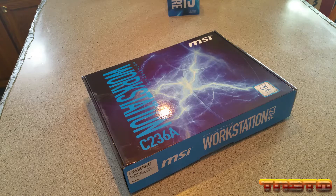This is going to be the first part of building our custom FreeNAS build. I picked out a workstation motherboard because it supports ECC RAM and has an Intel NIC. Workstation motherboards are a lot better than using consumer-grade boards - they're built more reliable, they can last a lot longer, and they're built to be on 24/7.